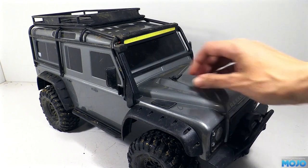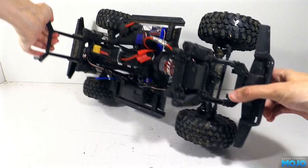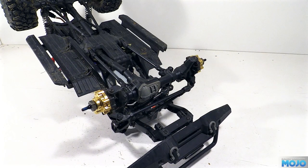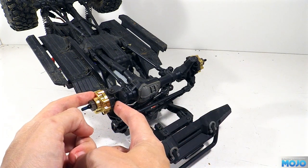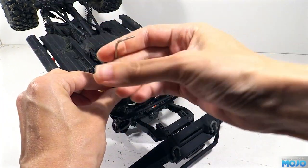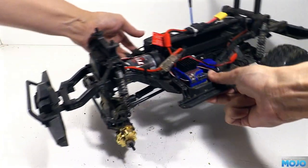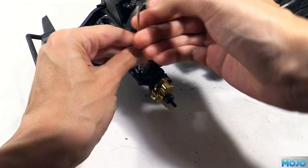Let's see about getting them fitted. First the body comes off for access, we can flip the chassis over, wheels off and we've got access to the hubs. They're really simple to remove — there's three points that attach them. From this side, we can remove the bottom kingpin screw. There's a small steel tube that sits in there too, so keep an eye out just in case it tries to roll away. From the top, we need to remove the screw that holds the ball end on.